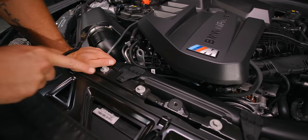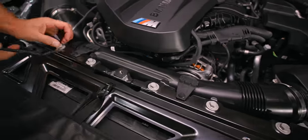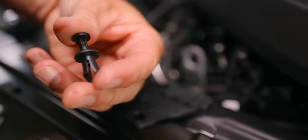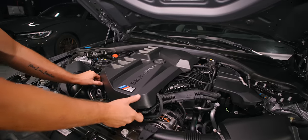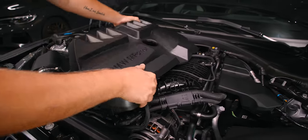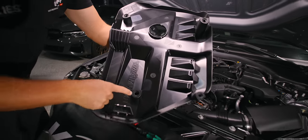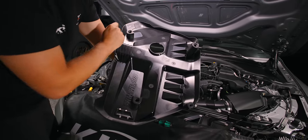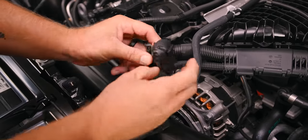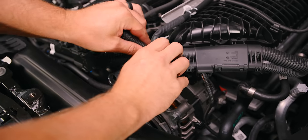Next, we'll start on the driver's side. To remove this side of the intake, we're going to remove this rivet over here and this one. Just take a little trim tool, slide it in, and then it'll pull up just like that. Next, we're going to get the engine cover out of the way. It's held on by four grommets — it's always best to work each corner by itself to make sure nothing's going to break. There's one here, here, here, and over here. Now to give yourself a little bit more space, you want to remove this connection as well. Simply press on the little tab over here and over here, squeeze that, pull it straight off, and then just set it out of the way.